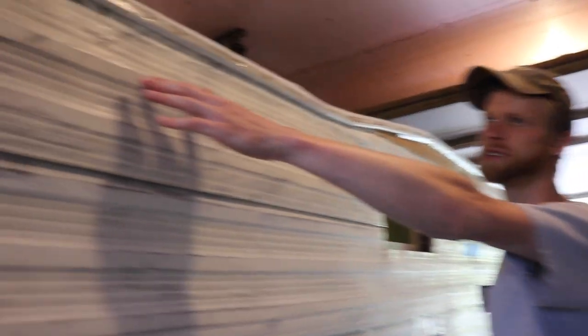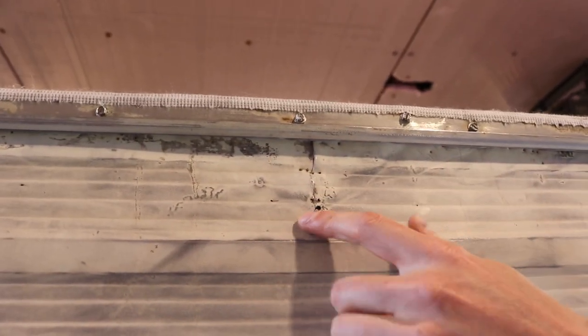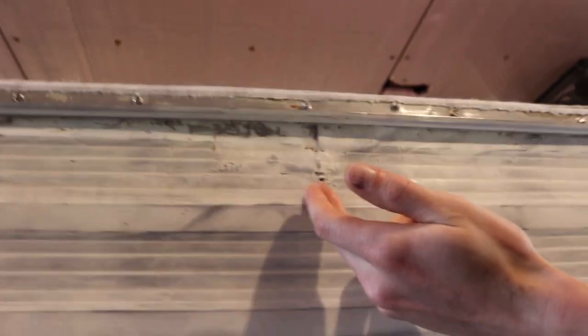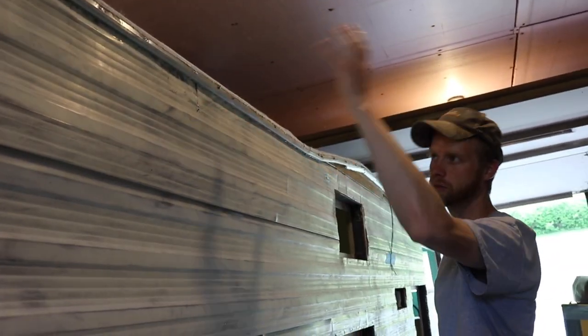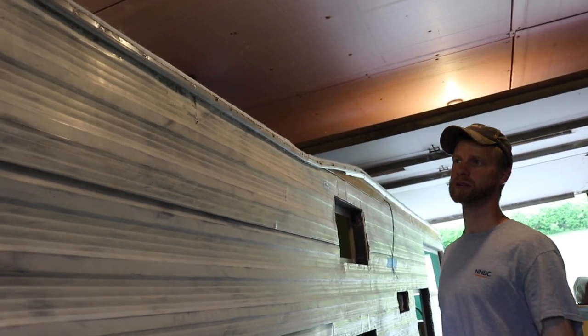Any staples that aren't going to get covered, anything where you have problems, like here's a prime example, there is a crack going down this aluminum. On the backside there is Eternabond roof seal tape, but as another layer, it's going to get the caulk.